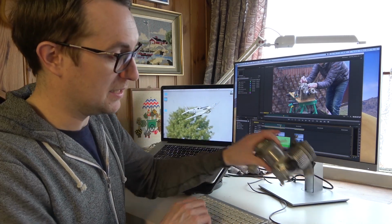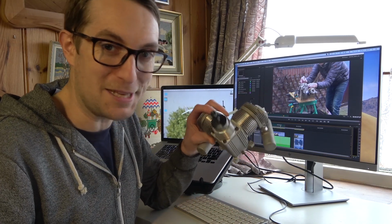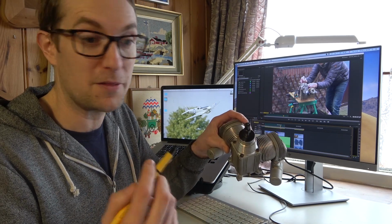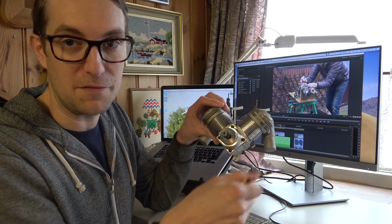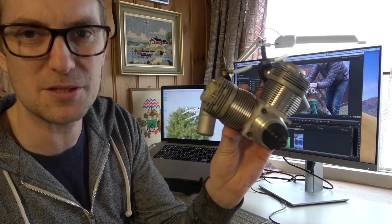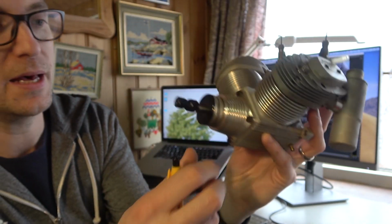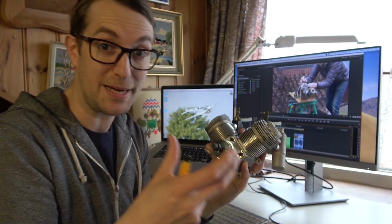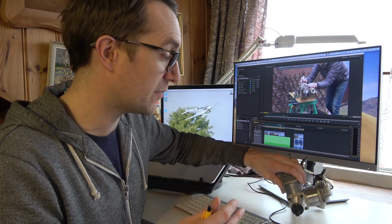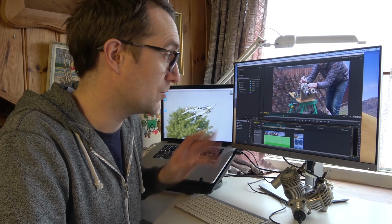So essentially what happened, a few nights previous to this, I was really excited about these engines and I wanted to have a look inside. I couldn't help myself. So I found a 3/32 Allen key, and this is the V cylinder, but it's the same configuration in terms of the front housing on the 100. And I unscrewed these four bolts to remove the front housing so I could have a look at the bearing and see what the condition was like inside. The great news was it was very, very good. Very clean, very pleased. I'm very excited to do more on this engine.